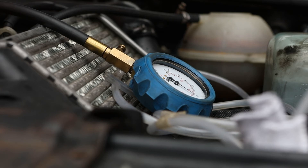Okay, second and fourth are okay. So the third one was the one with a big difference. There we go - looks like cylinder 3 has a slightly lower compression than the rest, which reconfirms in my head that we do have a blown head gasket after all. I think we're going to have to take the head off and find out - that's the only way.